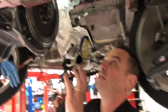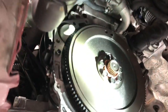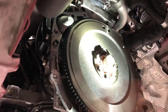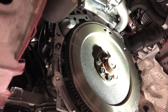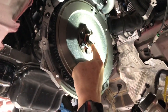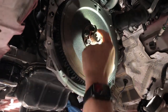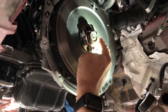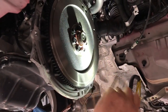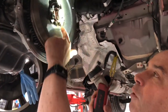Let's first have a look at the back of the engine here — you can see this is the flywheel with the starter motor here and the engine on the other side of it. Remember it is a similar engine to the Mitsubishi Evo 10 but it does have some distinct differences, and you can check that out in other videos. Now this part here is the drive that comes off the back of the crankshaft, and interestingly there is a superseded option for this particular hub drive to stop the rattling, which is a combination of that as well as the damper assembly, so be sure to check out that video.